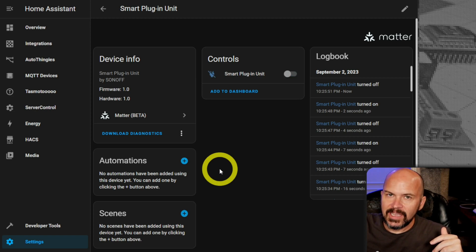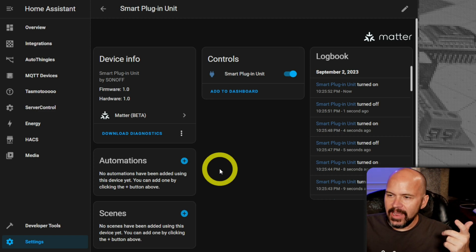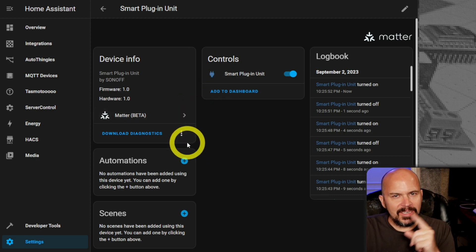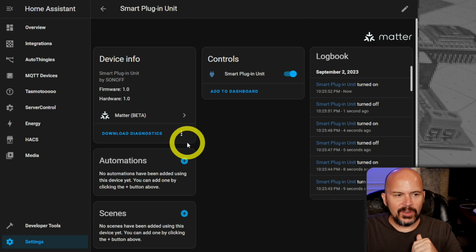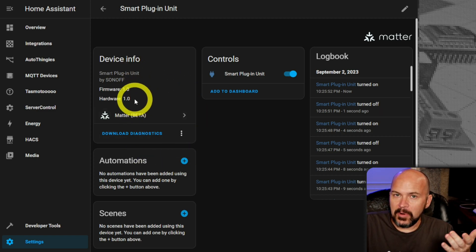It's meant for an actual light switch that stays on or stays off. You can see the limitation - if we had our own firmware, possibly I could add it into the eWeLink app, but that means adding it to the cloud to change configuration, which I'm going to pass on for a light switch in my house. That leads to another question: what about firmware upgrades - can we upgrade the firmware from the Matter integration in Home Assistant? I don't know of them doing that yet.